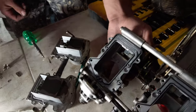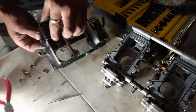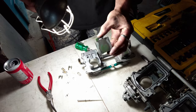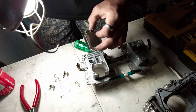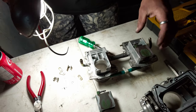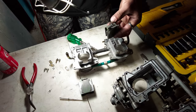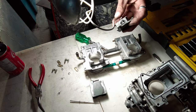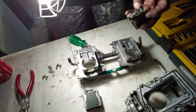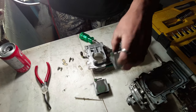These new gaskets are pretty flat — you don't want that either. It just slides out like that. So we got this little pin here pointing inwards to the carb, and this one's pointing outwards. That's how that's oriented — and that's all that holds that pin in. That thing swinging over was capturing it. Fancy stuff by Ski-Doo.